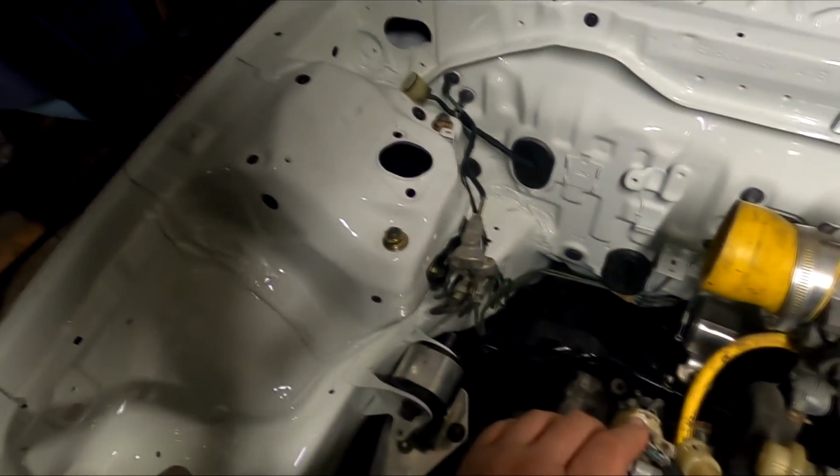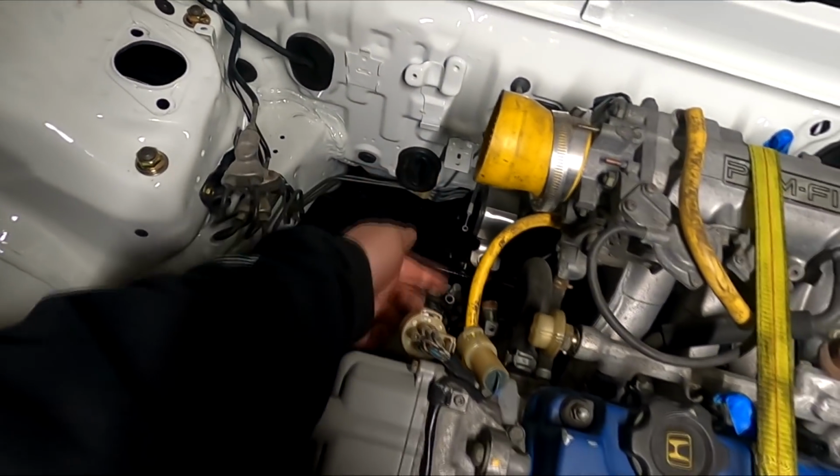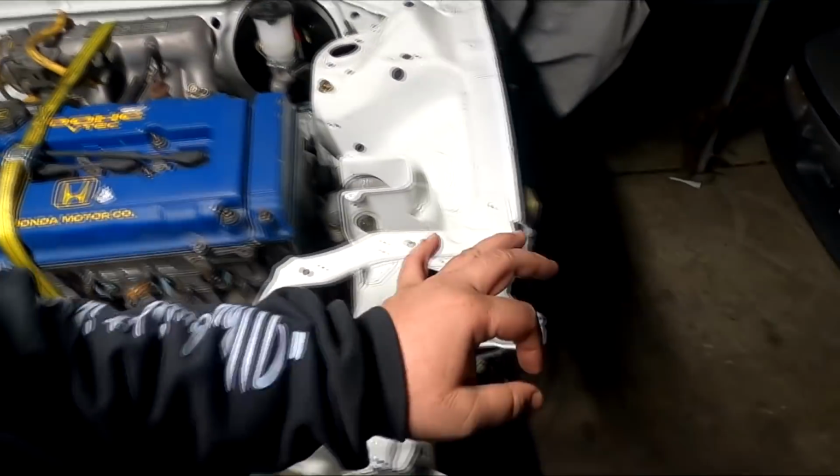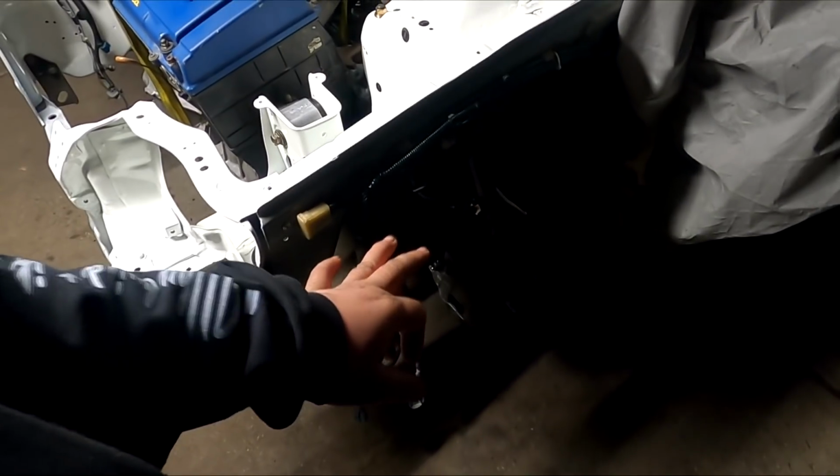It doesn't seem like much. I definitely need a rear T-bracket because this car came with a custom one. I am going to need axles because they were fitted for the old spindles, and they're not going to work for the new SI ones because these are 26 outer splines. Just small little knickknacks here and there.